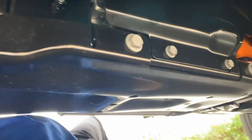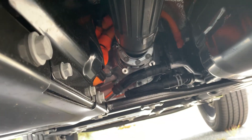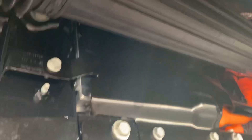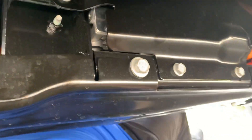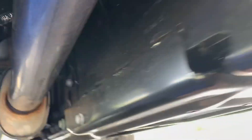The IDCM — the Integrated Dual Charging Module — is located here, sandwiched between the driveshaft. The driveshaft is there, and there is the transmission with the big heavy orange cables that go to this IDCM. This is a very important part of the hybrid system. It's also sandwiched right here between the exhaust, which runs right beside it — a lot of heat this thing is exposed to.